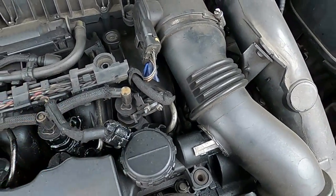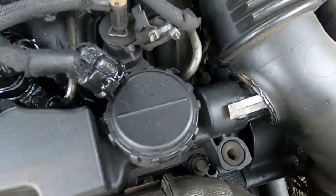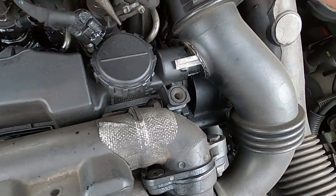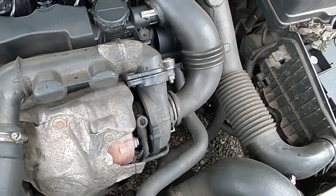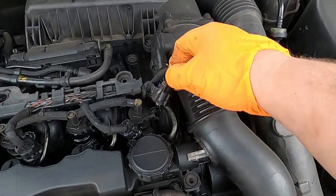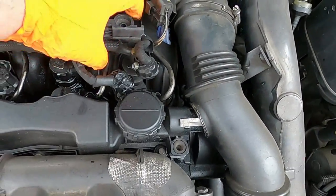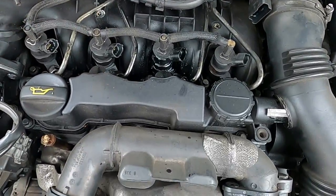My last one has been secured with something because it's a bit broken — I'm just gonna cut that off. Okay, that's all done, so my connector can come off. You also want to disconnect your mass airflow sensor connector. So all your connectors are off now.